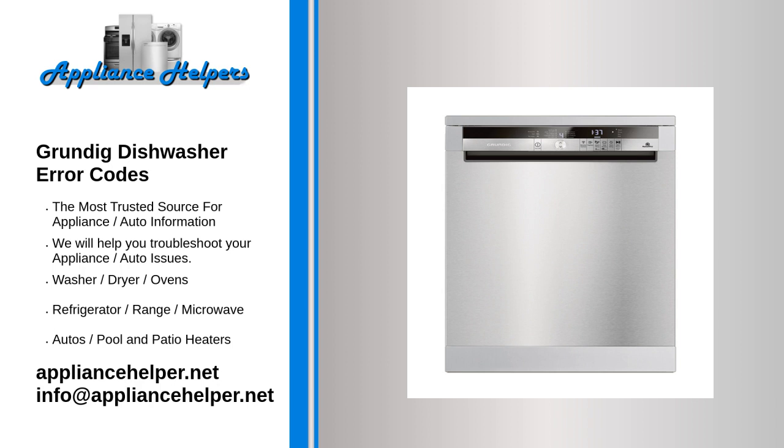C6: Water temperature is too low. The water temperature coming into the dishwasher should be at least 120 degrees F. Run the faucet adjacent to the dishwasher prior to starting it to purge any cold water from the line. Adjust the water heater temperature. Don't use the washing machine or take showers when using the dishwasher. Use options on the dishwasher to cause the machine to run longer and thus add more heat.